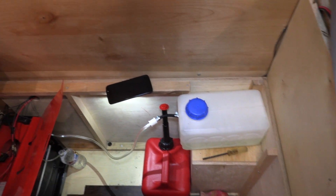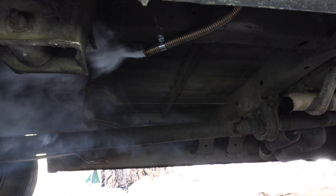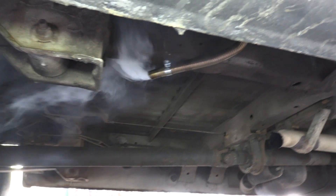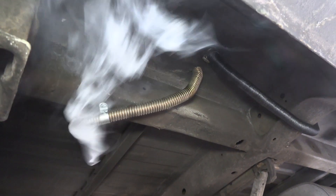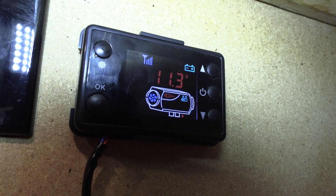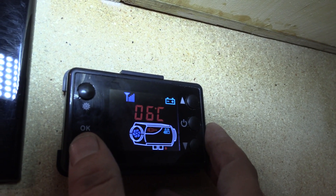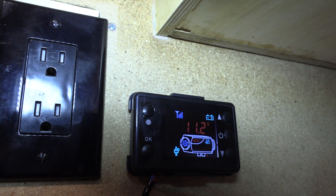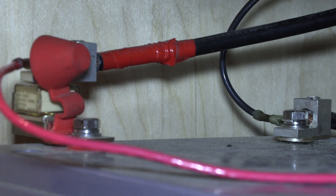It seems to be working. We'll see what it's doing outside if it's burning off any fuel. It's coming out — it's burning off a lot of smoke. And that's not even hooked up to the gas right now — that's just crazy. It's down to 11 volts while it's working. In the manual advanced settings, I did turn the pump way down so that it's not pushing that much gas into the engine anymore. 11.3 volts but it's not really doing anything. The book says it needs to be at least 11.5 volts and I'm at 11.0 right now, so that could be a major problem.